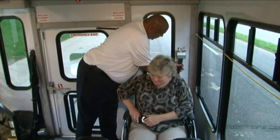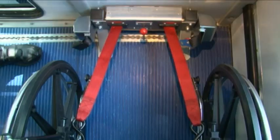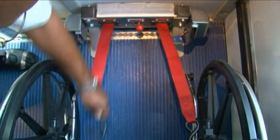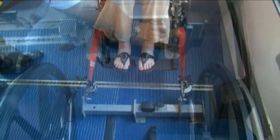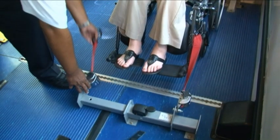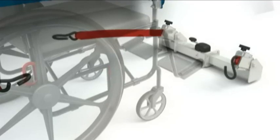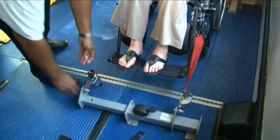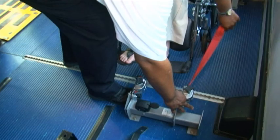Release the lap and shoulder belts so that they are retracted into their housing units. On the Dual Auto Lock, push the release mechanism down and to the right once again. Then, unhook the belts from the mobility aid. The belts will retract back into their housings. Move to the front of the mobility aid, press the red button on the housing unit of the belt and unhook the aisle side belt first. The belt will automatically retract back into the housing unit, but be sure to hold it out straight so that the belt does not become twisted. Return the ARM to its stored position using the pedestal release button and unhook the wall side belt.